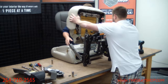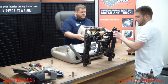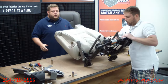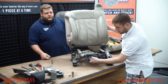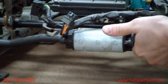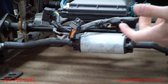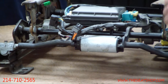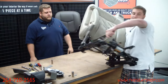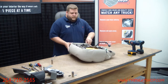We should be all free now — take that and there we go. If you have to get the seat off the workbench to work on the bottom cover, don't grab the seat by the motor — that's the motor that moves the seat forward and back. Don't grab it by that plastic piece because it can crack. We've had customers crack them — it was an $800 part from GM. Just grab the frame rail here, sometimes using a rag.